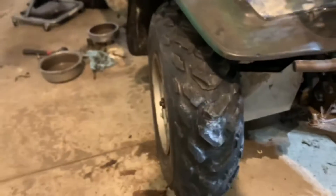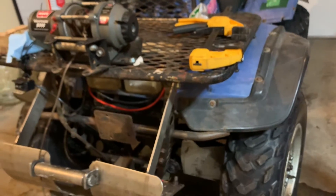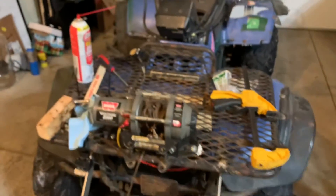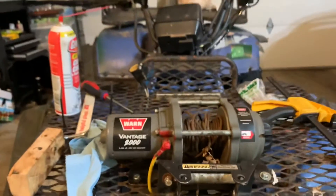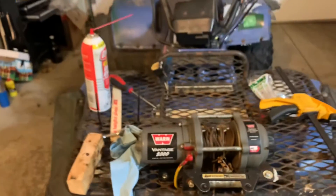The front brakes were gutted, so I ordered used brake hub assemblies for the front and replaced those. At the same time I replaced the front wheel bearings. You can see the winch isn't ideally mounted up here — it really should be down lower, but this kind of works for now. I've also touched up the electronics a bit.